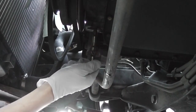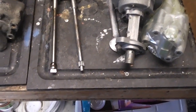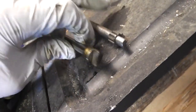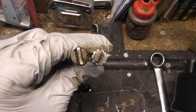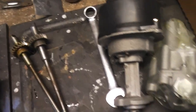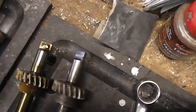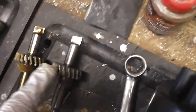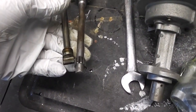Here is the distributor shaft. Now for a side-by-side comparison — I'm sure you can tell why you need to swap the whole assembly over, because the spindle inputs are totally different for each distributor. That's why you have to swap these out. Otherwise they're exactly the same — they fit into each oil pump the same way, the teeth are the same, they're the same length. It's just the inputs into the distributor that are different.